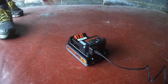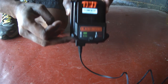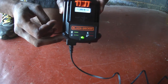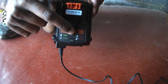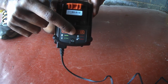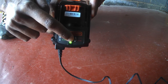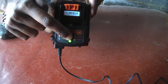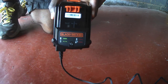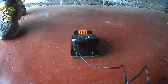It's worth mentioning that the charger is designed to detect certain problems that can arise with battery packs. If the red LED flashes in the pattern shown, it may indicate a weak or damaged battery — in which case, do not charge the battery and return it to the service center. If a battery is excessively hot or cold, the red LED will flash and the charger will automatically suspend the charge, restarting it when the battery pack is normalized. This feature ensures maximum battery life.